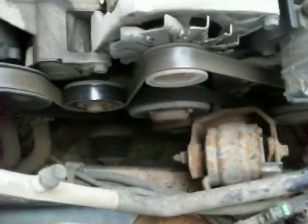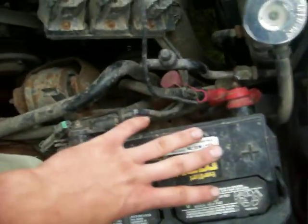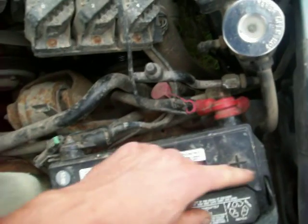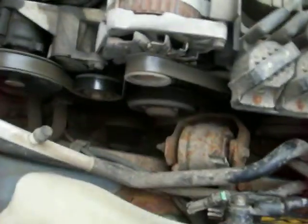From the factory they usually have a ground strap somewhere, but not really a big deal. The way I would do it is get one of those batteries that has both side posts and top posts. Hook up the side posts like you normally would, and on the top posts run one to the alternator and one down to the chassis and the other up to the engine — probably the easiest way to go.